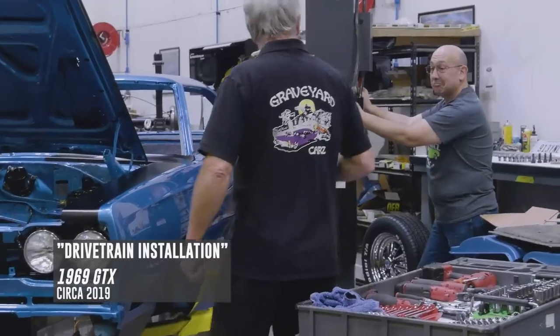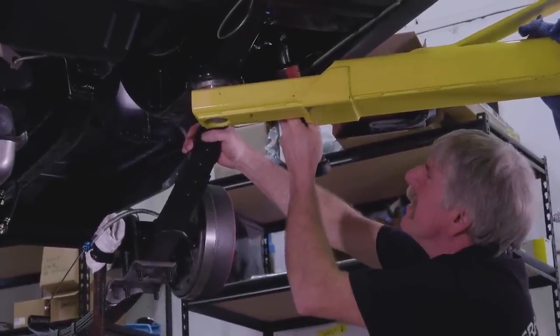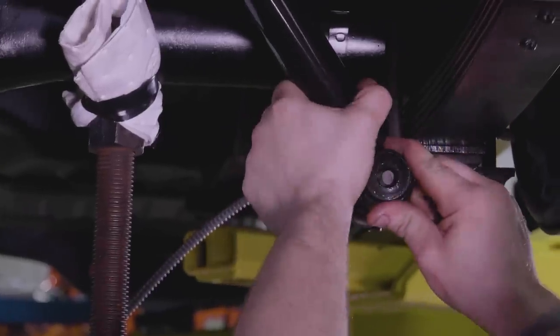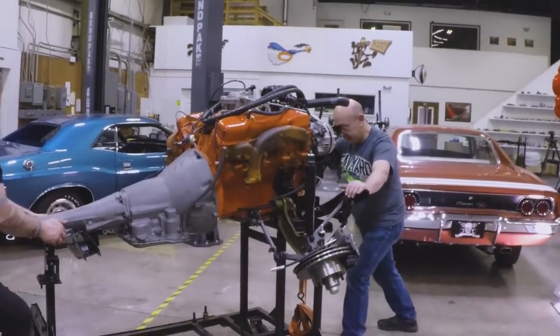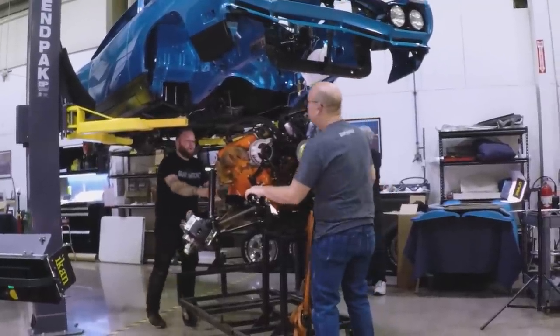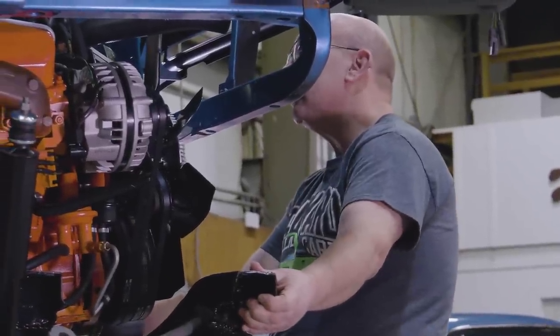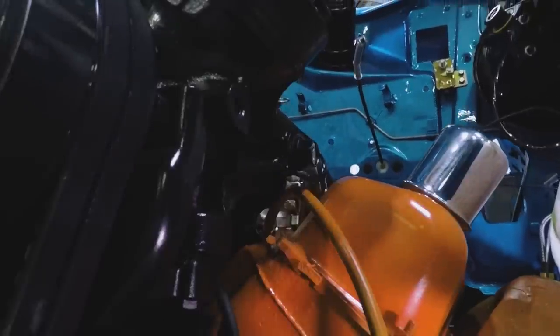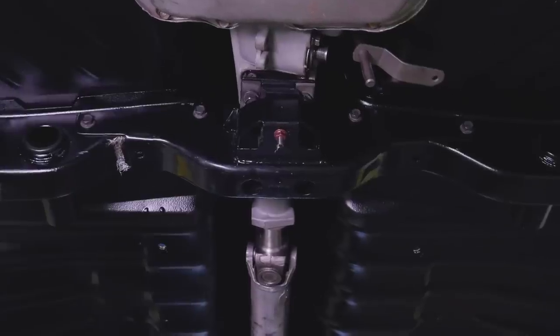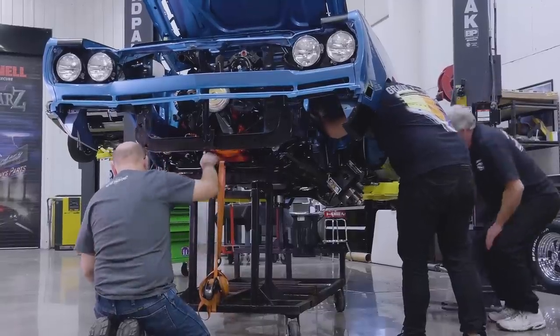Putting the cars together, we have a standard formula. Because of how the cars sit on the lift and how weight is distributed, if we don't put the rear axle assembly in first, it'll be very nose-heavy when we do the drivetrain. So we always install that axle first — it's around 400 or 500 pounds, but it's enough to keep the back end settled down. Leaf springs, leaf spring perches, shackles, shocks — then that area is done and we can move to the front. Once all provisions are in place, it's just a matter of making sure the alignment is good. You can scratch an inner fender with a valve cover or exhaust manifold, so the name of the game is line everything up and go slow. Once the K-member is seated up against the frame rail, you install the bolts. In this case it went together really smooth. Same for the transmission crossmember — lined right up, four bolts and nuts, and that's done.